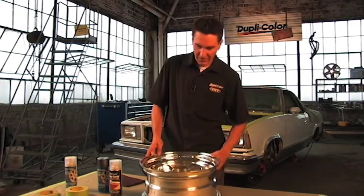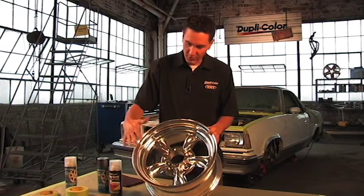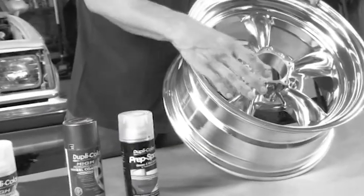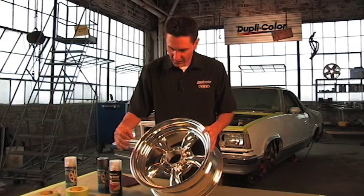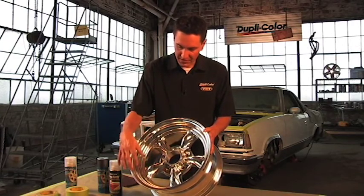We're going to use Duplicolor wheel paint and chose the gray to give the wheel a nice transition with the rest of the body. With any paint project, when you're going to have a lot of aluminum exposed or any bare area, you're going to want to use a high-quality tape whenever you tape this off. The reason for that is because you want to get a real crisp line in between your painted surface and your bare surface. We chose to use a pin striping tape that you would use on a paint job on a body.